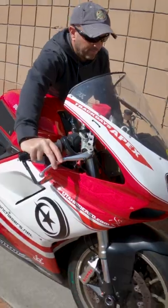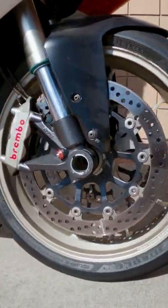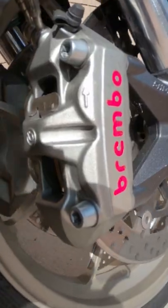To practice this delicate feel, walk next to our bike and slowly squeeze the brake lever until we can feel our brake pads begin to touch our brake rotors. That would be 1% brake pressure. Keep pushing our bike while our brake pads are against the rotors.